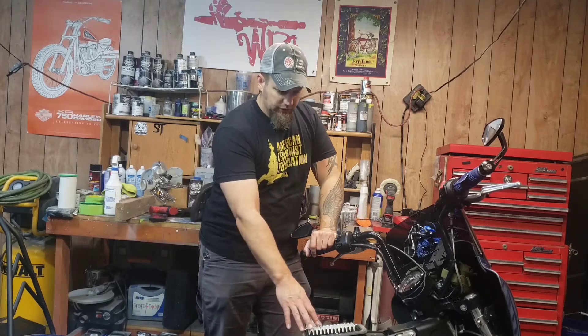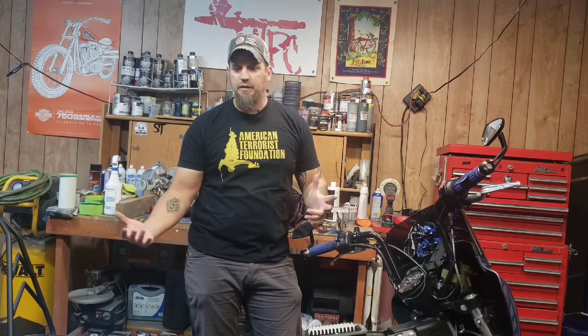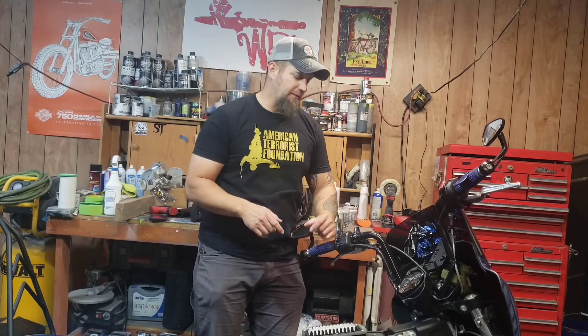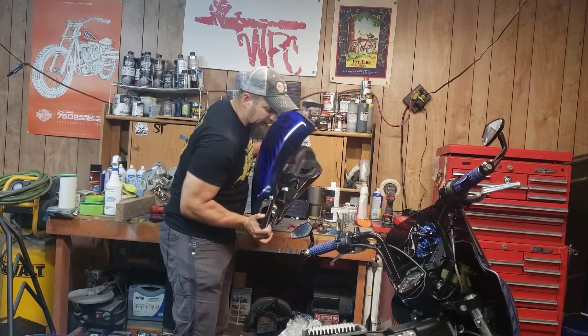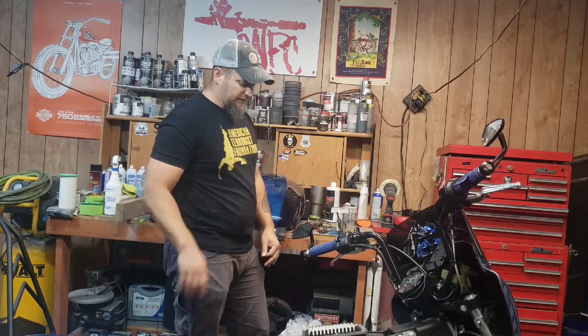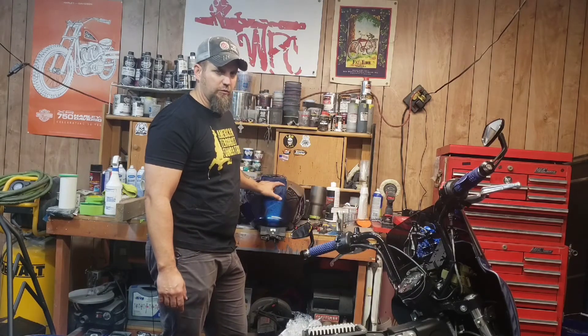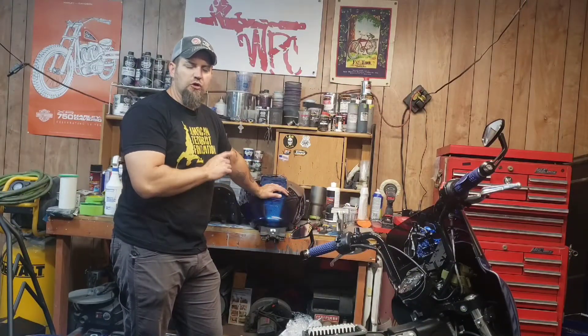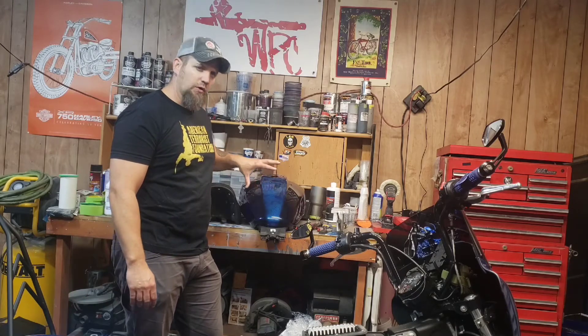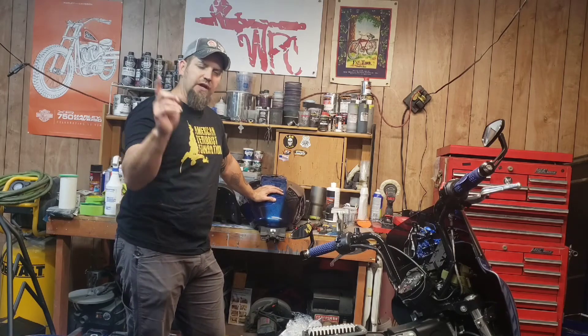Pretty much that's it for taking it off. If you're trying to change your air box, air filter, or do maintenance in here, it's that simple — four bolts, lift, disconnect, disconnect, pull. As I'm prepping, I'll show you the tear-down on the tank because the back side is where your pump is. That'll be on the video where I prep, paint, and do the airbrush art on it. On the next video I'll show you all that. If you haven't already, please go ahead and like this video, subscribe, help me grow this community, and rock on.